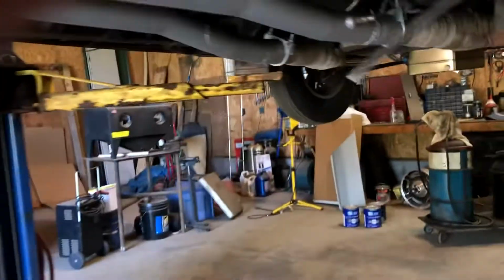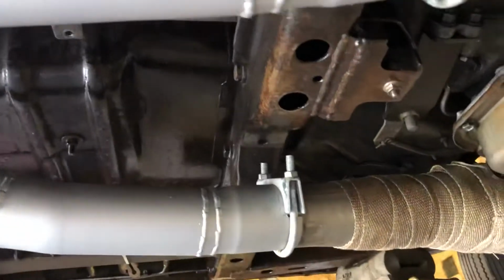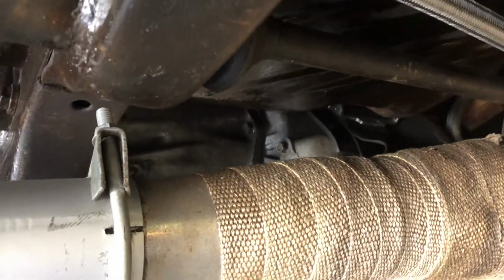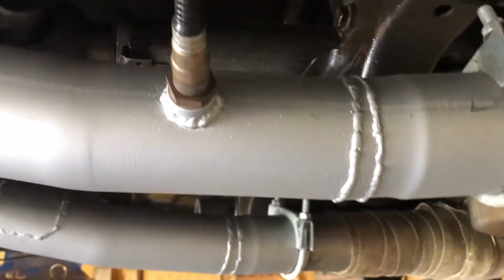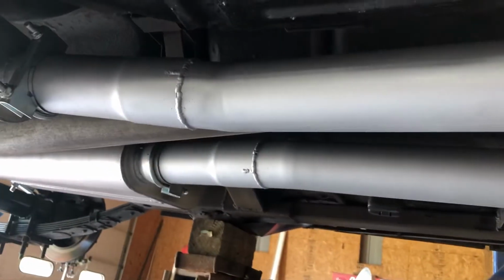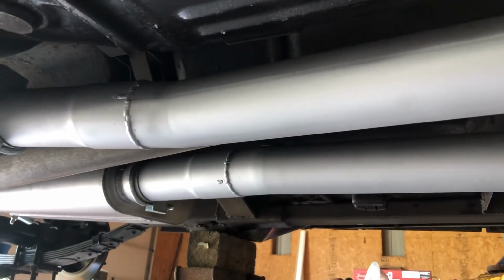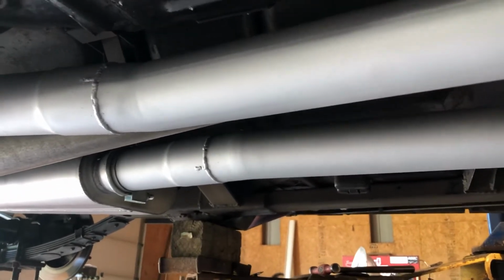The real trick to this though was this little pie wedge cut I had to do in each side, because you can see the transmission bracket. We tipped the tail of the transmission down a hair to compensate for the carbon fiber scatter shield on the transmission because it wouldn't fit, I think. This was years and years ago, I don't really remember. But the headers are down a hair, so that made everything down here 3 inches low. Before, when I had a side out exhaust with a Spintech muffler with an oval side exit, everything was way too low and I hated it, it looked like crap.